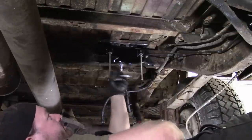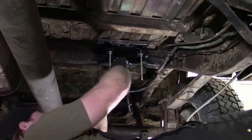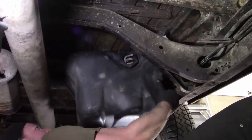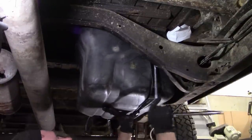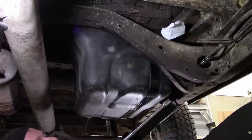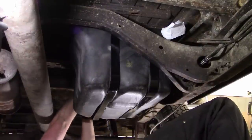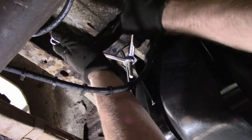This meant bolts would not be a great way to secure both ends of the straps, as it would be awkward to prevent the bolt from coming loose. So I cut down some all thread to make studs for the rear mounts. These I installed using the standard double nut method, and locked them in place with another nut. Then it was just a matter of jamming the tank into place and getting all the hardware done up to the appropriate tightness. And I used a double nut to lock the straps at the rear.